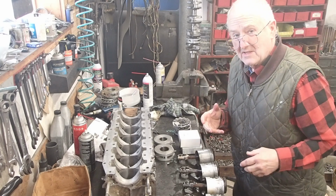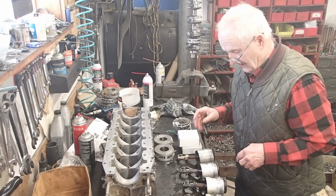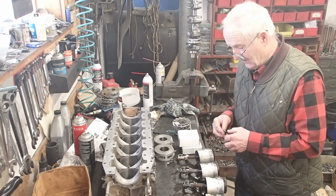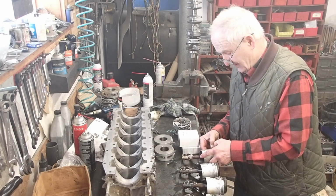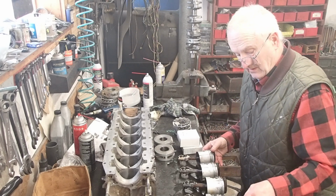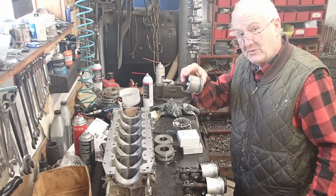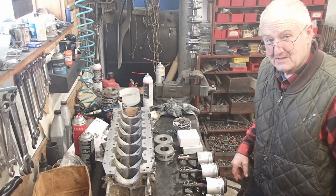I'm putting the rings on the pistons in preparation for putting them on the crankshaft. And doing that, because I'm not too interested in using this as a fishing motor, I'm putting used rings on the bottom one or two lands. I have two different pistons here. I've got two ring pistons here and three ring pistons here because finding the high crown pistons is difficult.